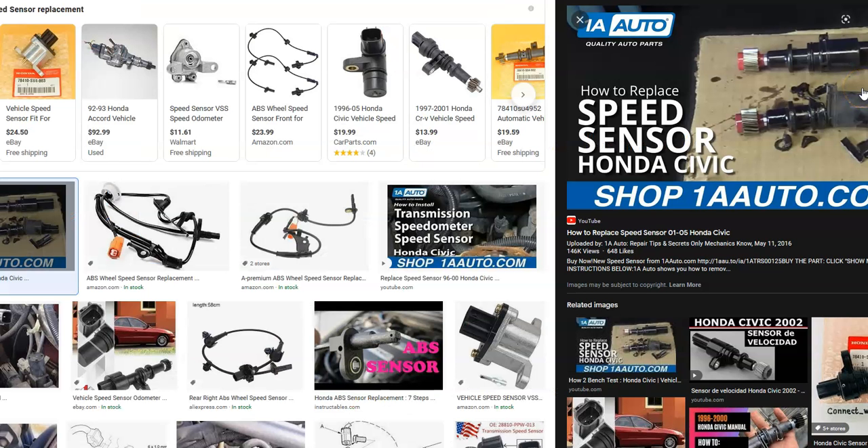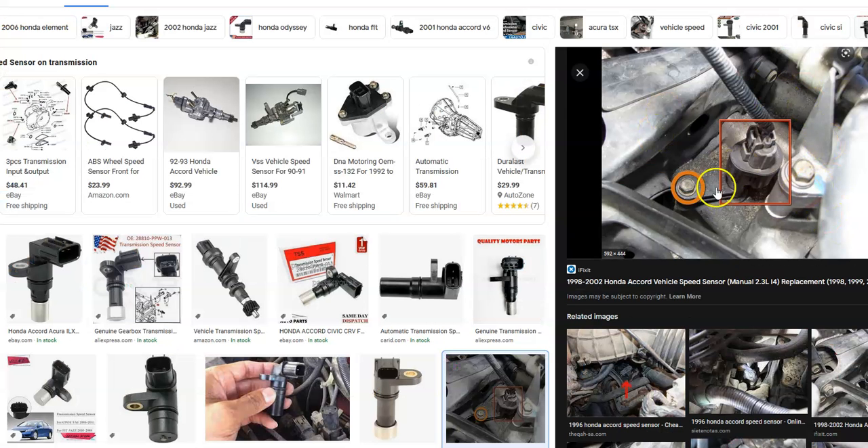So what do you do if you have a Honda with the P0501 code? Well, first thing to do would be to Google where the sensor is located on your vehicle, because there can be differences between different years, engine types, and things like this. You want to locate the VSS sensor, or vehicle speed sensor. Once you locate it, be sure to check out the wiring, because the wiring harness was notoriously bad on these and can cause issues.